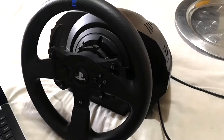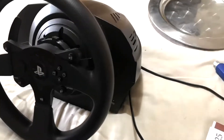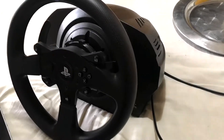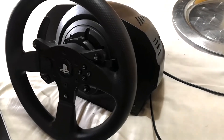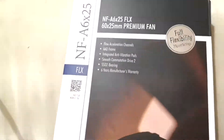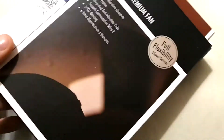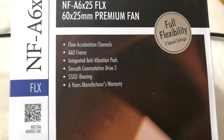Today's job is to replace the fan in this T300 wheelbase. The bearing of the fan is starting to go out. Because I keep this on forced cooling all the time, which probably didn't help, but it's quite a common modification slash upgrade and it's a common thing to fail. This is the fan I'm replacing it with — it's a Noctua fan, about £14 off Amazon, so not bad at all.